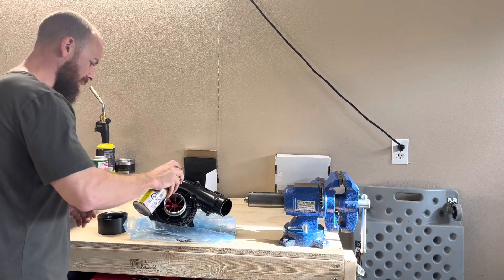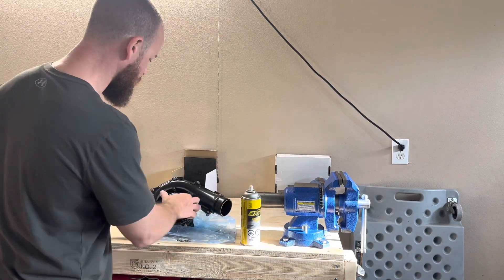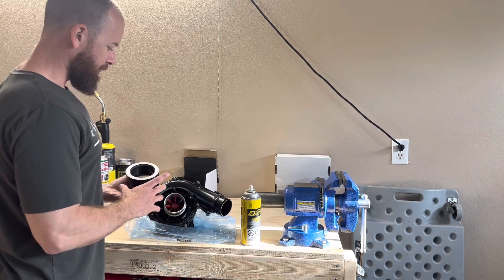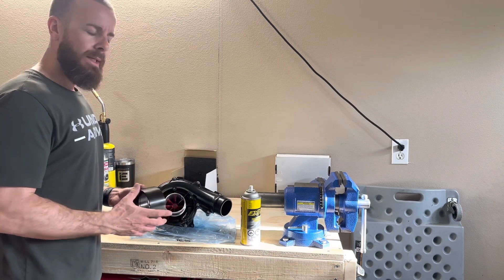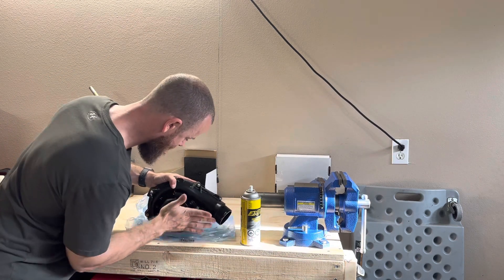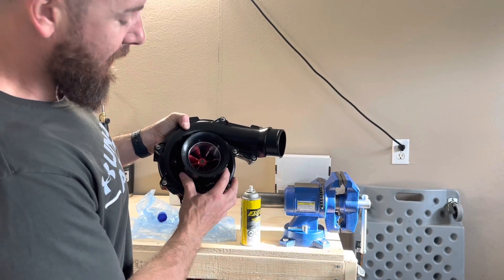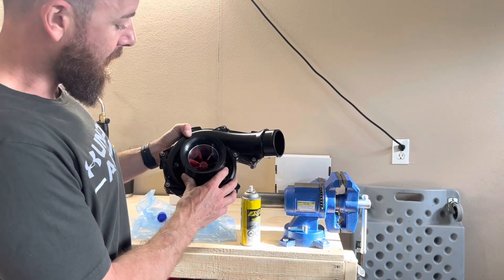It's a good idea to put some anti-corrosion on this aluminum here, and we're going to use that to lubricate the velocity stack as well. Links to the velocity stack, the supercharger wheel, and the upgraded supercharger washers will be in the description. Now placing the adapter on — there you go. You can see we've got a nice smooth transition from 4-inch into here. This thing is really nice. Shout-out to Bautista Racing Team for taking care of me.